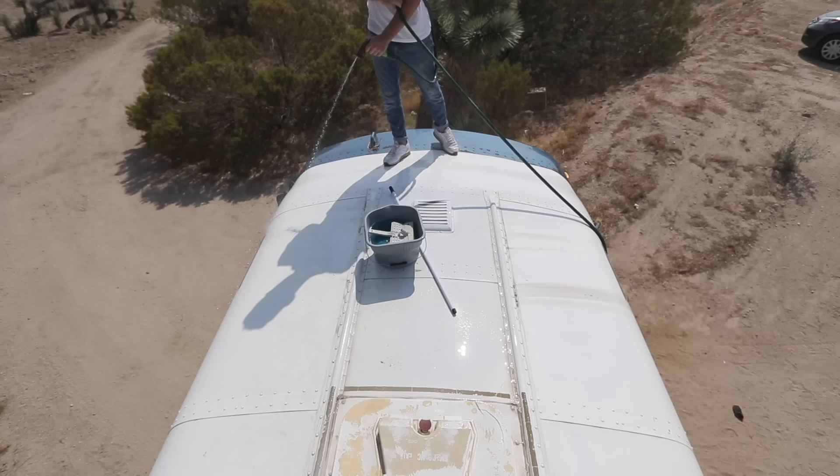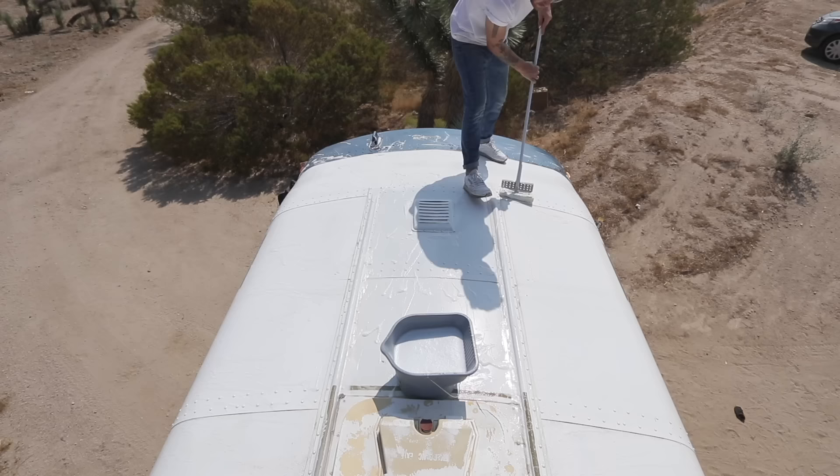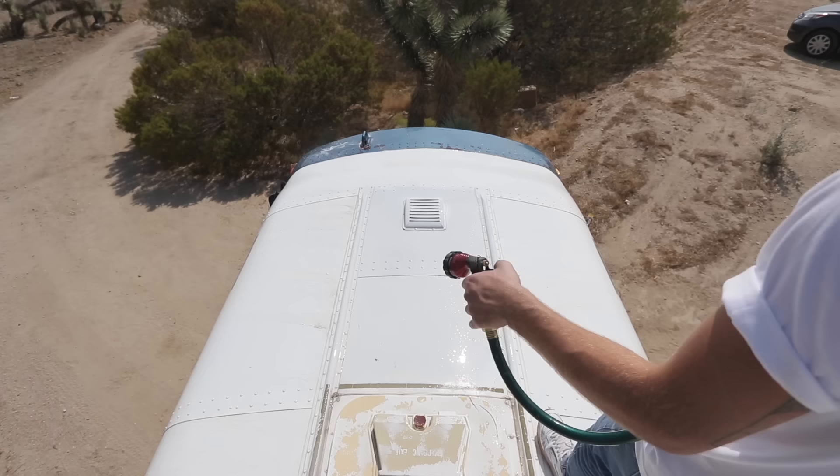After finding this out, I did a little more digging online and on a lot of forums, people do recommend using dish soap to wash a car before paint. That way you can get through all of that crud, grease, and the top coat of wax so that you can get a good bond with whatever primer and paint you're using.